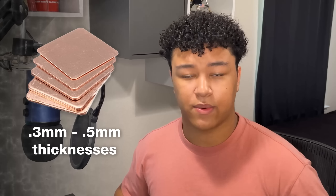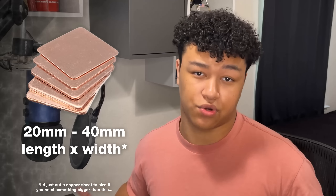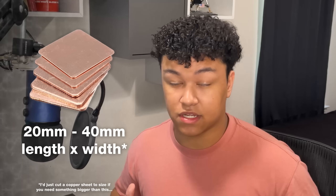Let me make an important note here: not all GPU dies are created equal. Therefore, the shims that worked on this RTX 3060 might not work on your own. I would stick to the same thickness of 0.3 millimeters; however, the actual size of the shim could be bigger or smaller. In the case of something like an RTX 3080 or 3090, a 20 by 20 millimeter shim might not be big enough to cover the entire surface. I've left a variety of sizes down in the description. Make sure to measure the size of your actual GPU die first before you buy anything to mod your GPU.